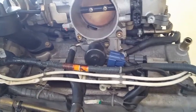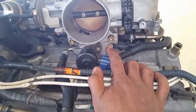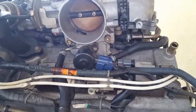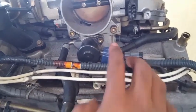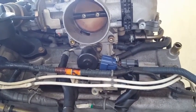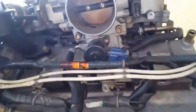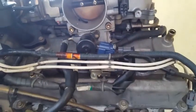The understanding that must be gained from this throttle body heater block is that when the coolant becomes acidic or corrosive, it will most likely eat away at the gasket or the casting in the throttle body. That coolant will then begin to leak into the induction system that's inside there, and this will cause damage to the engine.